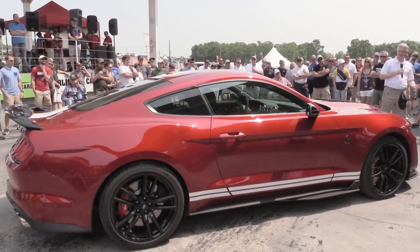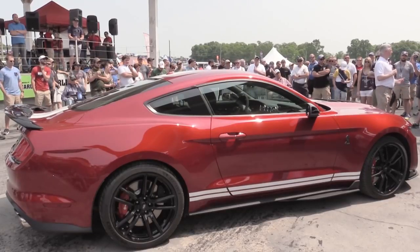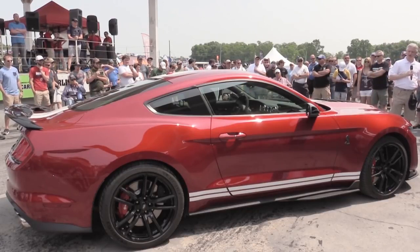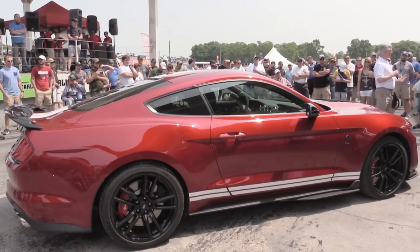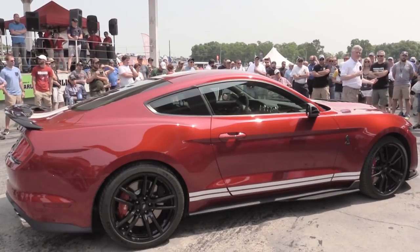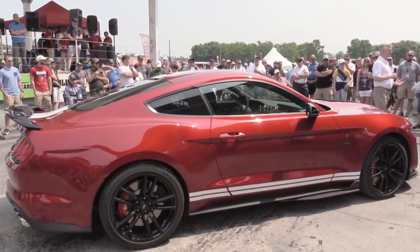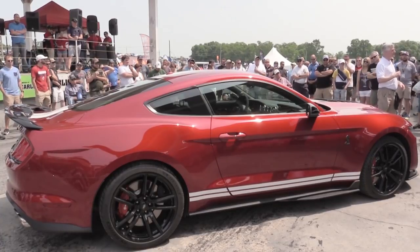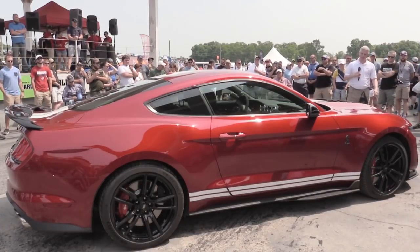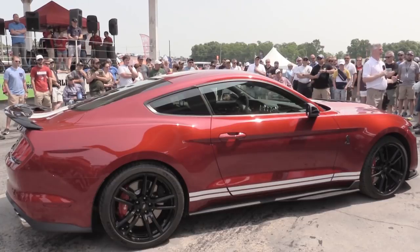We have a dedicated aerodynamics team. This is probably their fourth Mustang. And that partnership we have as we do these Mustangs between the aerodynamics teams and the studio teams can create what is, you know, 50% more airflow through the coolers and twice the front opening of a GT350, but it comes out as it's all fluid. The motion looks like it's moving when it's standing still. And that's all unique from the A-pillar forward to accomplish that task to match cooling capability and downforce.